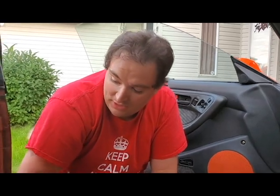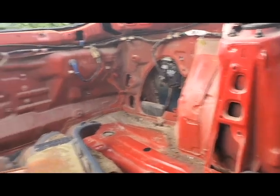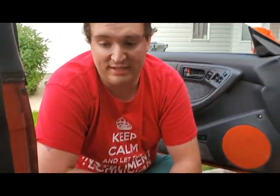We've also got rust on the passenger side that we found pretty quick, so we're gonna have to deal with that as well. But overall we don't have a ton of rust. We'll seal the floor with something like Por-15 to kind of chip the area up and then put the carpet right back over top. I just wanted to be open and honest about what we're finding with the Celica. The back is pretty good - Tyler can do a bit of a sweep. We're gonna clean it up. Reality is this car should be fairly clean by the time it's done.